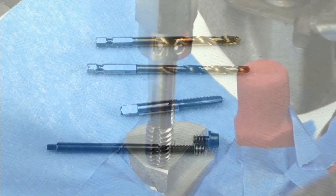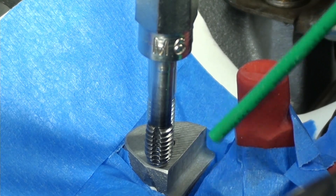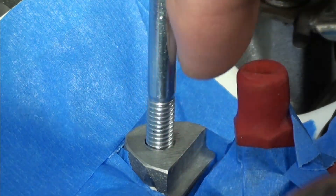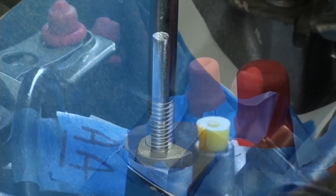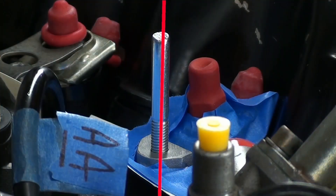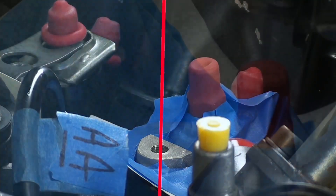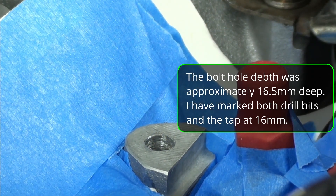Let's go ahead and take this stuff over to the engine. The first thing I did was take an M6 chase and chase the bolt hole, so I could thread in a bolt and know exactly what that angle looks like. I have another camera angle here — I've created a laser marker, so I can take a line and see the angle of everything. That matches up with my other angle; that is a 90-degree from this angle. This is obviously an advantage that most people aren't going to have. I'm going to start with the 15/64 first, all I have to do is line up my lines.